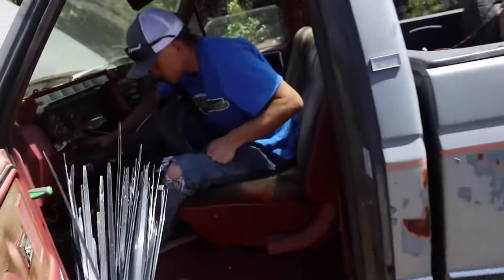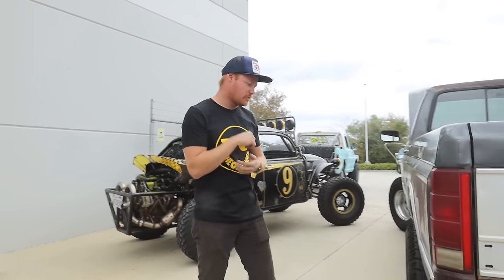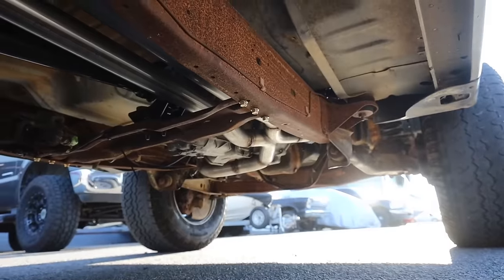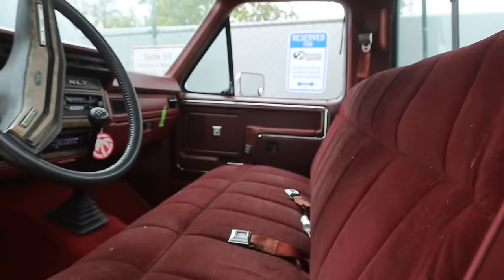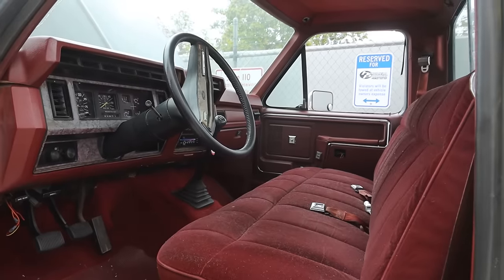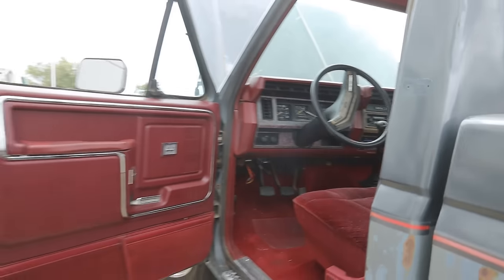A lot of this is sentimental to my cousin. I was about eight years old when he died, so I didn't get much experience with him. The truck had a LaPresti license plate in California — my last name — and my uncle kept those plates. I registered it in a different state where a family member also named LaPresti lives, and put the correct plate back on it. I gave the truck a full mechanical restoration. It has a full Black Widow stainless exhaust, stainless headers. It's a five-liter, and we swapped in a ZF5 speed — a small block ZF5, very hard to find.